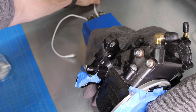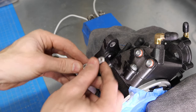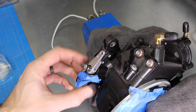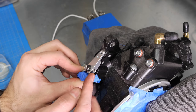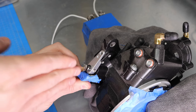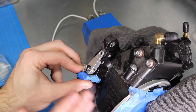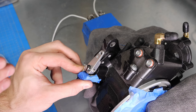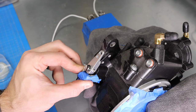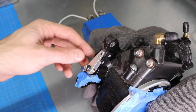All right, so now that we have the little piece of the throttle spindle shaved off the end here, that is gone. The next step is to slide this whole throttle linkage down on top, and you're gonna wanna tighten it up there like so. And you'll see I've got a little grub screw here. Now I've added a little Sharpie line on the end of this so I know just how far down that flat needs to be ground down. So that flat actually needs to go down so that this can locate against the flat. And then of course we'll tighten this down and this will get held in place and it'll actually actuate the throttle. Pretty cool stuff. It's not super complex, which is pretty cool. Just a little bit of modification.